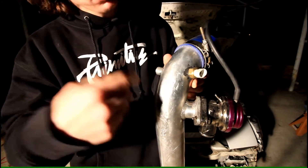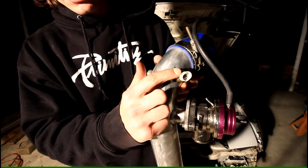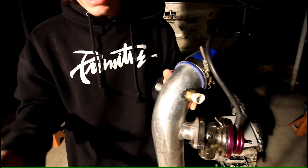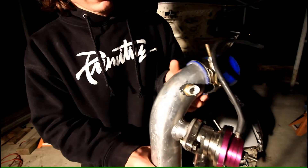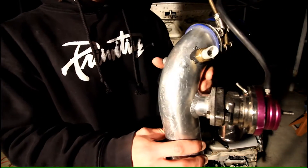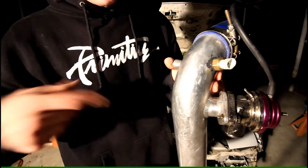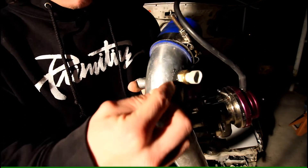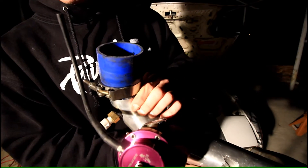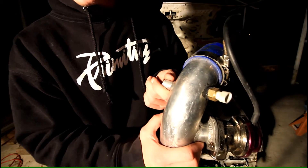The wall on this isn't really thick and the sensor has straight threads, so I don't expect it to be really airtight and not create a boost leak. What I did was I threaded it in and snugged it up, but that's about it. Then I just went all the way around it and put JB Weld all around it to hopefully keep it airtight and not have any type of boost leaks.